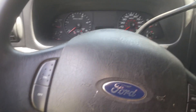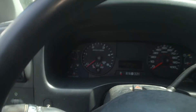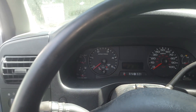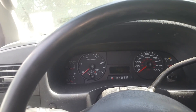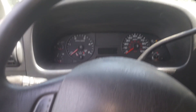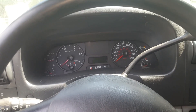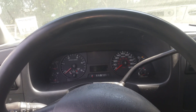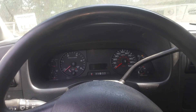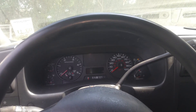I was having extreme power loss with this truck. I wasn't even getting a reading on my turbo PSI at all — even though the sensor was plugged in, the stem was broken off the tube so it wasn't reading anything. But that fixed the entire power loss problem right there — just that little sensor. It's running really good now, idling well. I didn't realize that a little MAP sensor would just completely shut your power down like that.